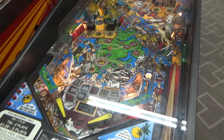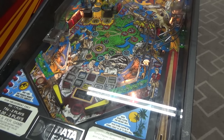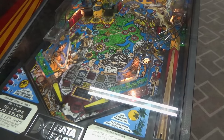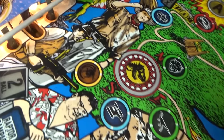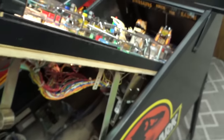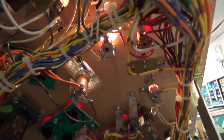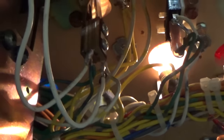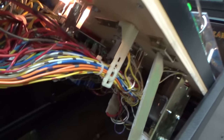Whenever you're working on any kind of pinball machine or arcade game, look for clues. The clue here is none of the lights work, but two of them do — so what is special about those two? I looked in the manual and it does not specifically mention those lights as controlled lamps. So I took the glass off, and if you look at the wires running to that bulb, they are white and yellow — the same wires running to the general illumination.